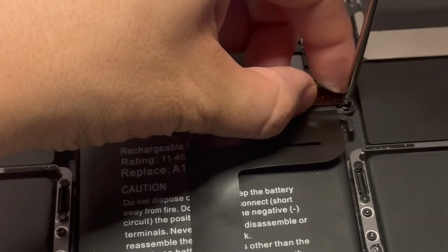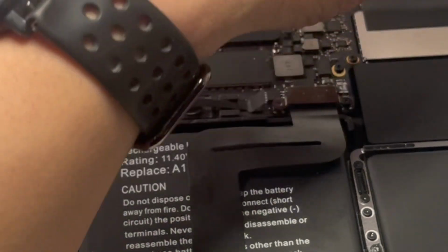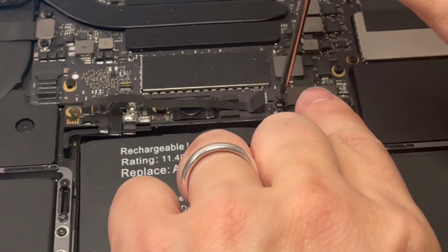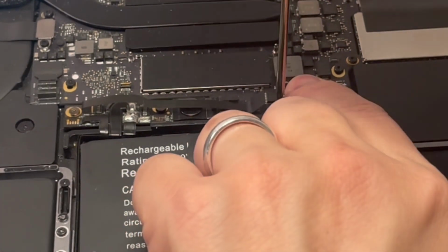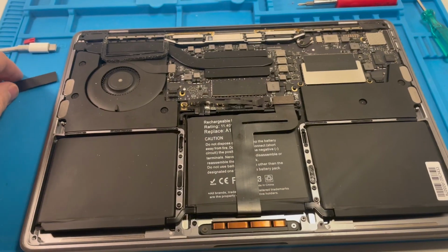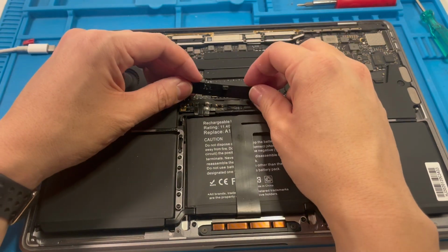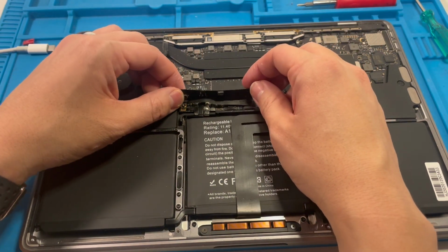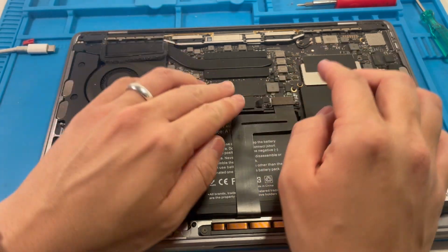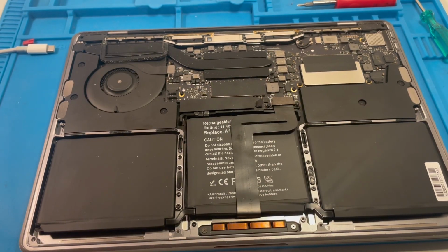So this is the trackpad cable cover. It's got these tiny Torx screws that go over here. Okay, good. So one of the last things we're going to do is to put this adhesive over the top of this. So this aligns with that screw hole there, and this cover just goes over like that. It kind of protects this whole section. And then we're basically done.